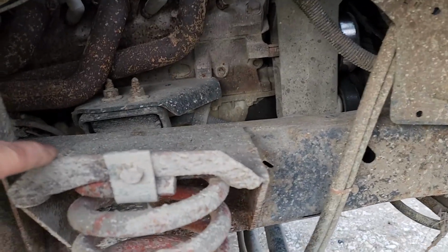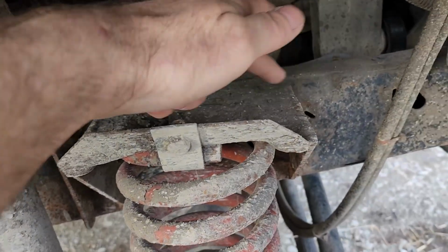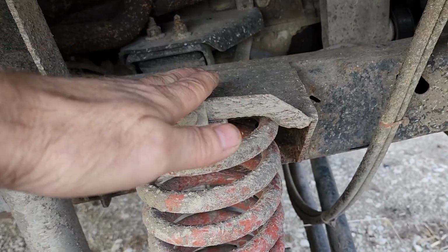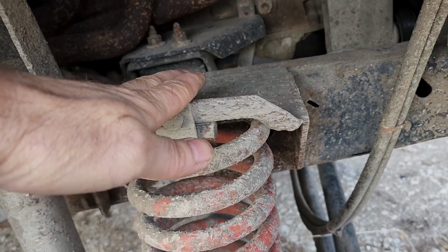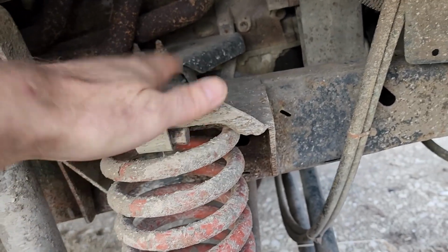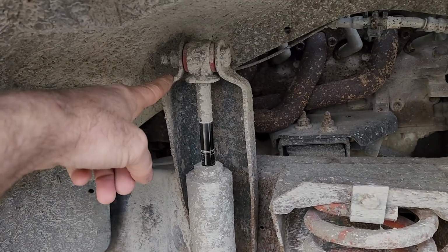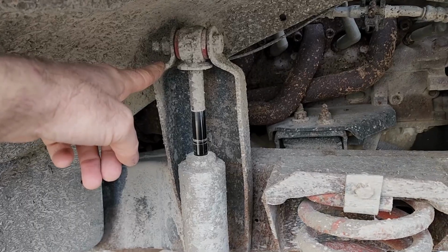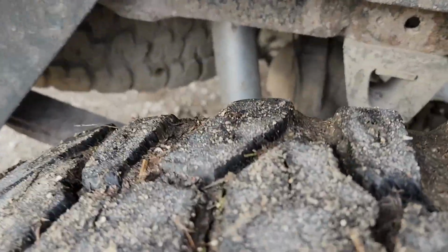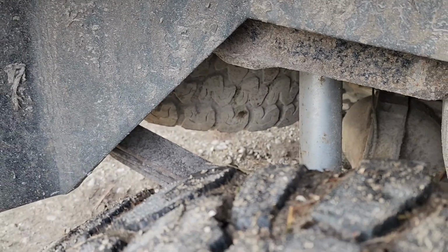Now these coil spring buckets, these are homemade, obviously, as you can tell. I just cut the top out of a Ford coil spring bucket. They just would not work in its configuration for the amount of lift that I wanted. So I just used the top out of it and built the sides. The shock mounts, those are from like an 80s or 90s F250. I don't think I did anything for custom mounts back here. Did actually manage to squeeze a full-size 33-inch spare back there.